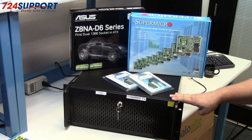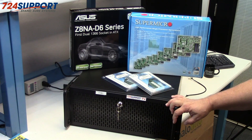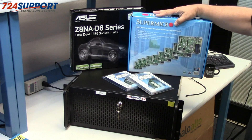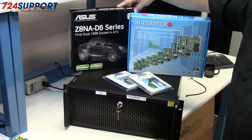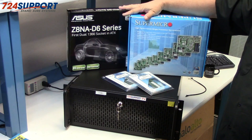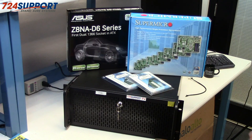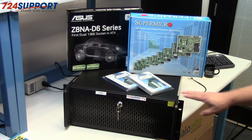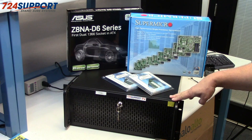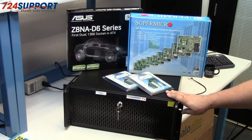This will not decrease power like the green 1U Atom server we talked about before, but will reduce noise dramatically. The basics of this will be a 4U chassis — there are a variety of those. A Xeon motherboard — here's a Supermicro version that's a single Xeon, and here's an Asus dual Xeon motherboard. These are both 1366 motherboards, tried and true and work really well. One's already installed in here, but you can use a variety of other motherboards depending on your specific needs.